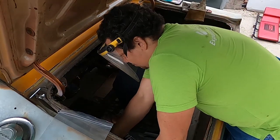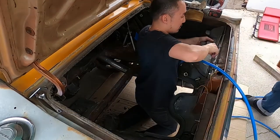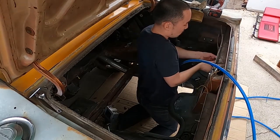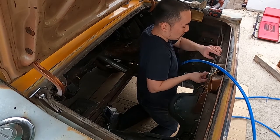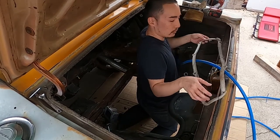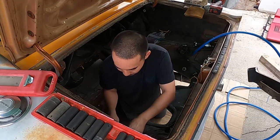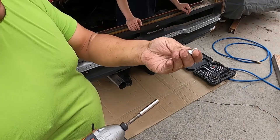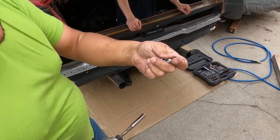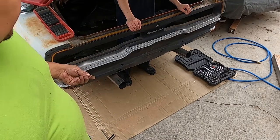I started removing the tail lights just to give us more room. I do leave the tail light panel in there so things stay equal across the board. There are only eight nuts holding the tail lights in, so they're very easy to remove — just make sure you don't damage the foam. I also remove the bumper because it's in the way to get to the lower valance on the rear. I had already cut the lower valance out at one point and just screwed it back in with what I call zip screws — tap screws you can get at Home Depot. I drill them in to hold pieces in place temporarily before welding.